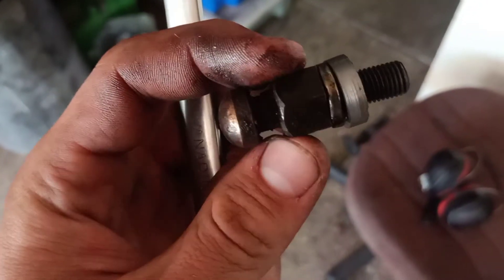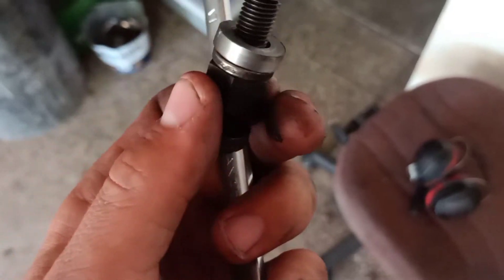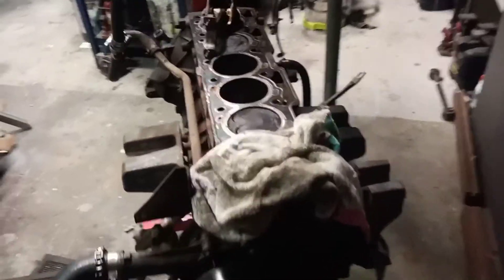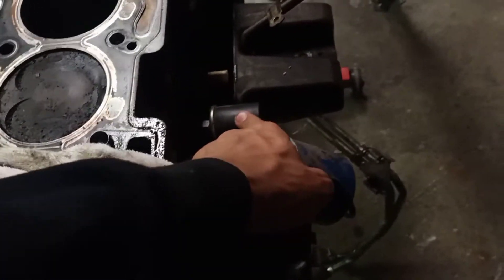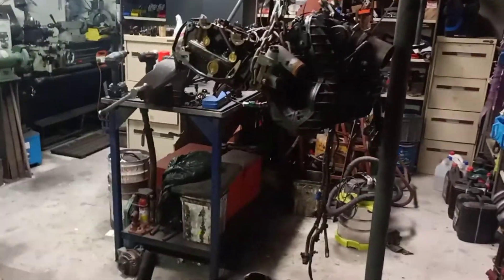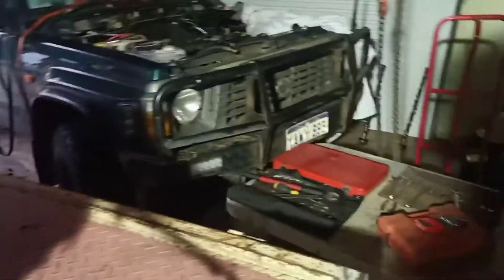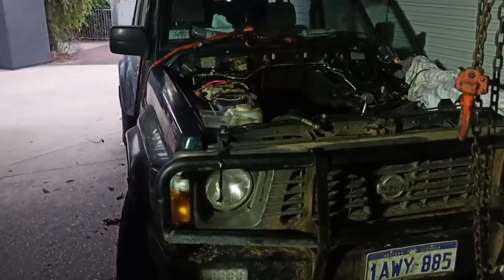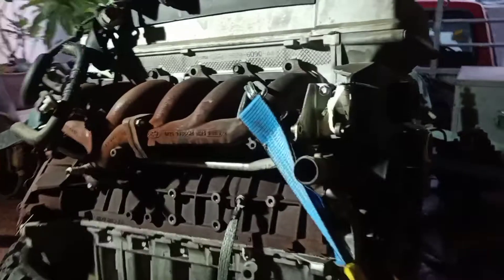That's the little spacer I just machined up. It's pretty rough and ready but it should do the job. I'm gonna smack it back in now and move on to the next thing. Here's the old block — got a few bits in it like the oil pressure sensor and a temp sensor up there in the thermostat. Here's the new engine, so I'm going to swap all that over tonight, get it ready to drop in tomorrow, and it should be in within the next day and a half.